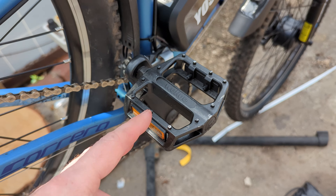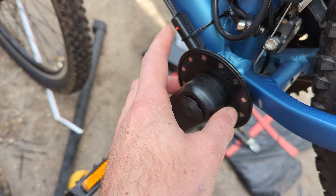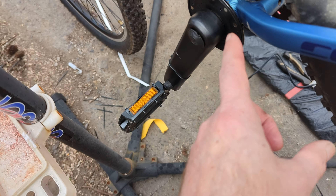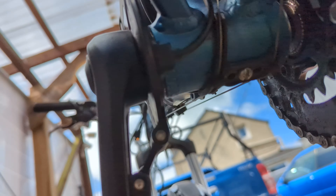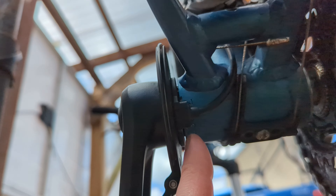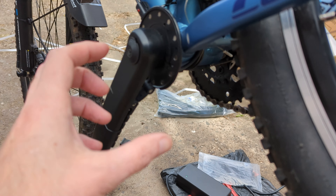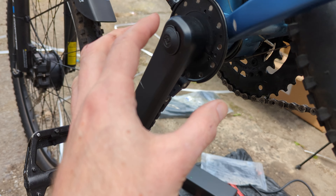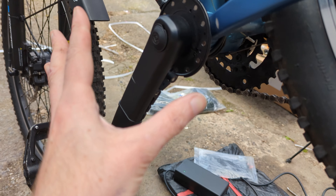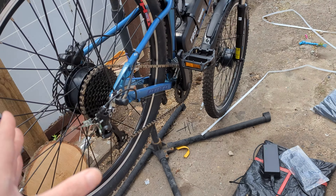Then on this — wait, it's the wrong side. With the Switch Bike kit, you put on a disc and sensor that fits on the outside. With the Yoss Power one, there's one that goes on the inside. You actually have to take the pedal arm and the pedal off the crank, then you put the sensor on and put it all back together. The Yoss Power Kit comes with the tools for pulling it off and pushing it back on, and the special tool you need to get the gears off the back wheel. All those tools are included along with the allen keys.